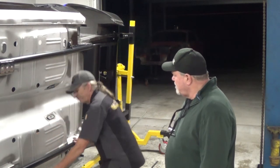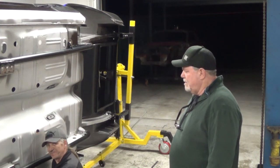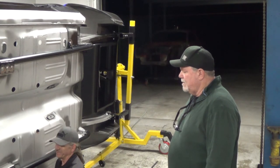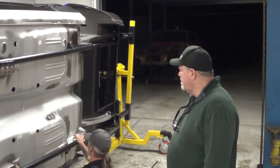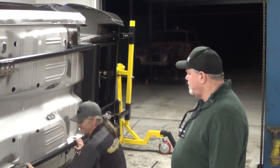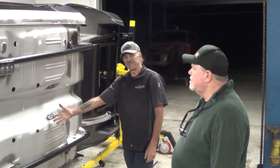Then we ended up finish welding it, and we smoothed out the weld, so if you were here feeling it, you could feel the bump where the weld is, but it's smoothed out just so it doesn't look like a rough weld. They are all clamped down when they were finished welded, so these are both complete, tight, straight, and there are your pair of subframe connectors.